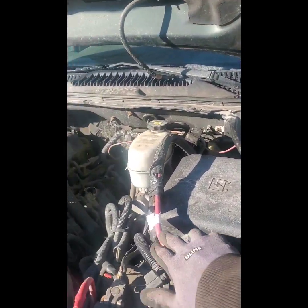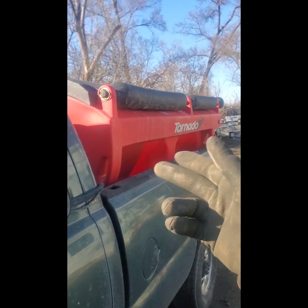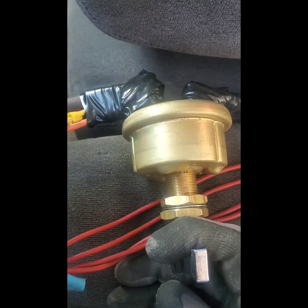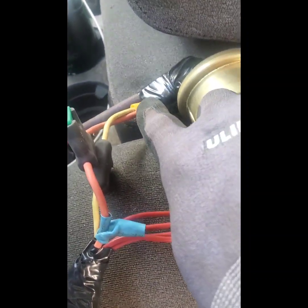About the salter - I'll show you. This is very primitive how I did it. This is my battery, my negative - I ran it through the firewall. I literally did this on the day we needed to start plowing and salting. When we first installed it and hooked up the controller, the salter spinner spun once and then everything died. The reason is whoever had this before hooked up all the strobes, all the lights, the vibrator - everything to the module - and they overloaded it. So once I put it through the firewall, I ran my wires through and I hooked it up to my switch.